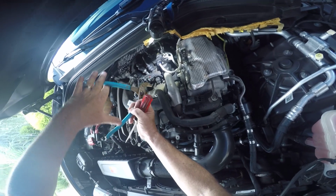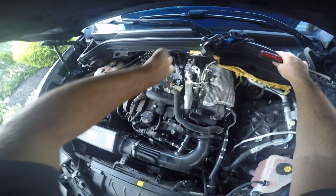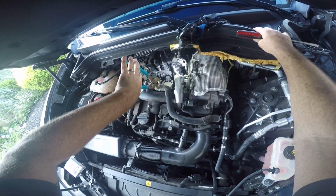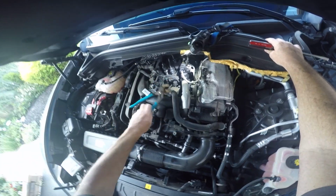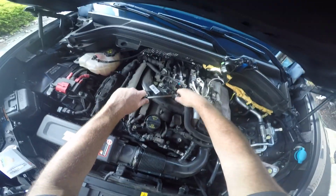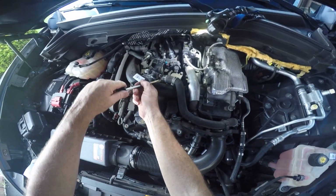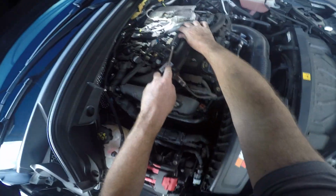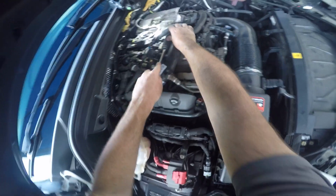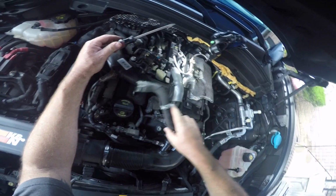Now, like I said, I'm going to move this big hose out of the way, and I'm going to use my channel locks to loosen the clip that's on there, and I'm just going to pinch down on it and jockey it out of the way so I can free it up. I like to use a screwdriver on these hoses. Sometimes they're stuck on there pretty good, so I use a screwdriver just to help pry it away and create some space and kind of break the seal a little bit. And this one was a little bit stubborn, but just take your time. You don't want to split the rubber, and just kind of jockey it back and forth, and it'll eventually pop off.